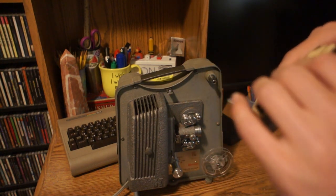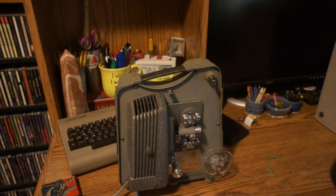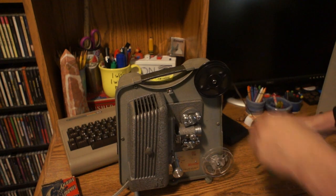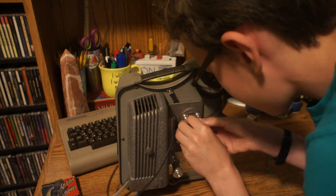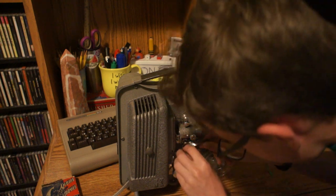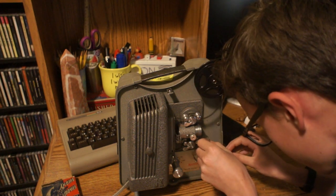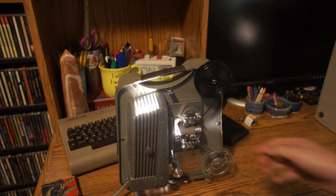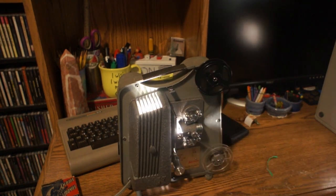This does not accept full 8mm size reels. We have this Castle Films 8mm Sinbad the Sailor — I don't think it's even the real one, it's just a film. Lining up these reels is actually kind of a pain, but we're just going to spool it on with perforations out. We run it over this roller. This one's a little bit more labor-intensive — I think it's an auto-thread. Then we're going to pull back our film gate here, thread it through the gate. Then we are going to put it over the second tooth arm and thread it onto our take-up. We are just going to move this to motor and lamp. Just focus that in there. It's a standard 8mm projector — this is black and white; I have color 8mm films.